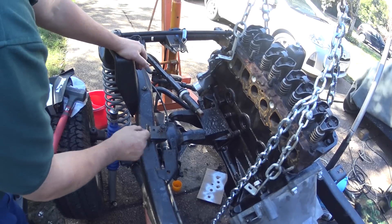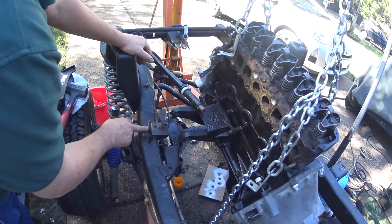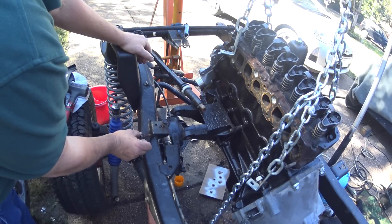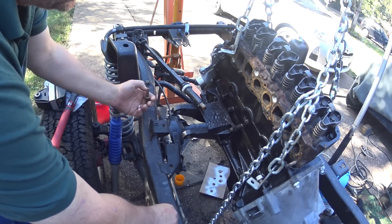This is actually the bracket here that's in the way of getting my motor mount on. I'm going to take a wire wheel and look for the weld spots and cut it off. Then I can measure it on the other one where it goes in. This one's not as critical as the motor mounts, and I can measure where the motor mounts should be from my old one that I saved.